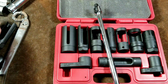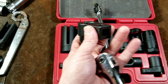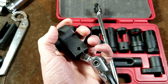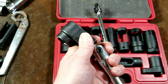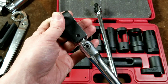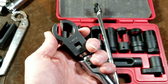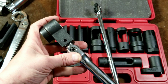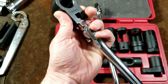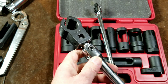Here's another style of oxygen sensor socket — they could have included one like this where you can drive it from the end. This Blue Point allows you to drive it from the top, but you can't drive it from the bottom — it's kind of weird the choices they made. But it allows you to have it pretty straight and use a half-inch drive to get a lot of extra torque. I really appreciate the Blue Point because of how extra thick the walls are. The other nice thing about these end-drive sockets is that you can flex them either direction, making them more convenient to use. And if the oxygen sensor gives you a lot of trouble, you can turn it 90 degrees, use it as a wrench, break that sensor off, and use an extractor to get the inside out.